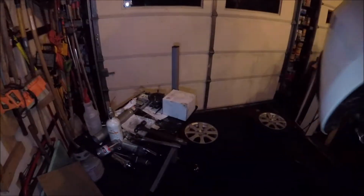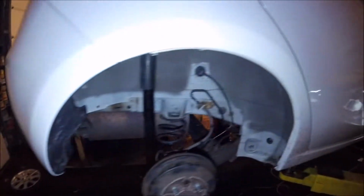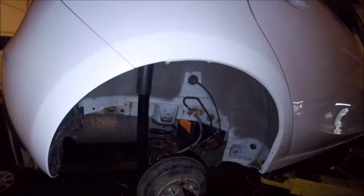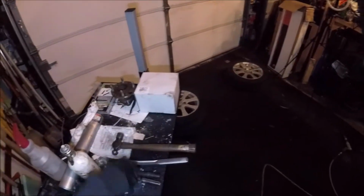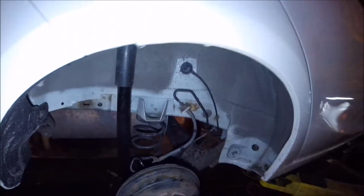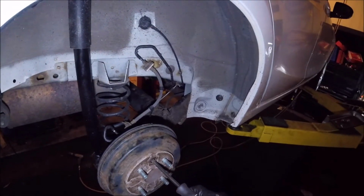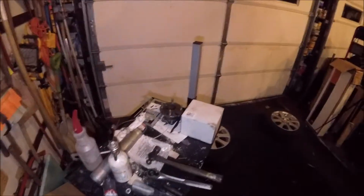One thing, if you don't have one of these, definitely pick it up. It's a vessel impact screwdriver, and just basically because on the Japanese or Asian cars, that little drum holder, those little screws that are in there, they're not an American standard, even though this fits in here. You can't twist it out.